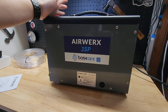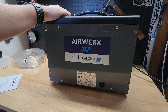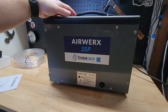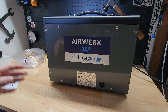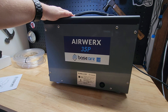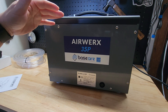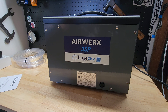This is for mostly basements and crawl spaces. You may have a situation in your garage or shop that you may want to use one of these. It's really important to use a dehumidifier to reduce humidity — if you have high humidity in an area, you're going to get mold and mildew. It's unhealthy and uncomfortable. Some people just have to use a dehumidifier 24/7. You want to keep humidity generally between 40% and 50%, and you're pretty good to go.